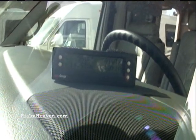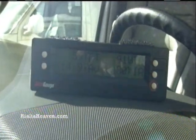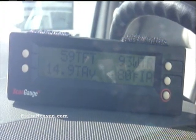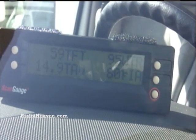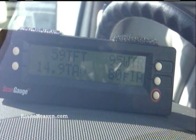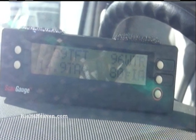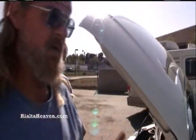I hooked up the scan gauge so we can keep track of the transmission fluid temperature. You can see it in there — the TFT is now at 59. The sensors they use are not extremely accurate at low temperature ranges, so it's probably warmer or cooler than that. One just to the right of it says WTR — that's the water temperature. Now without a cooler, the transmission temperature will normally lag behind the water about 20 degrees until the water gets up around 200, and then the transmission will just go right on by. As you're going to see, the water is going to get extremely warm before the transmission gets any heat in it.